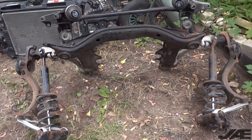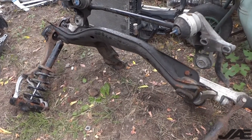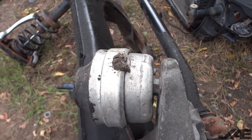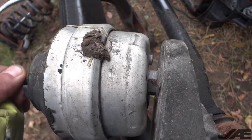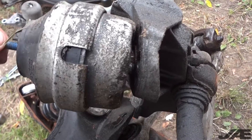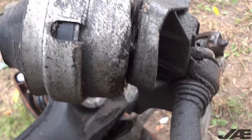So this subframe was from a V6 that actually had a V8 swapped into it already, done by a shop, which did some questionable things. Another interesting thing I found today is for the motor mounts — I guess they wanted to space the motor a little bit higher for clearance, and they seem to have just stuffed an extra large nut in there to prop the engine mount up. Unfortunately, while that may have worked for that side, this side is completely wrecked. The bottom of the motor mount pulled right through, and the nut is now inside of the motor mount, and it is completely loose.